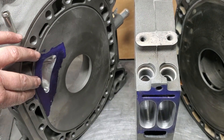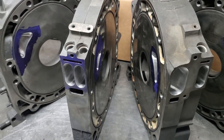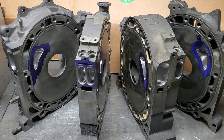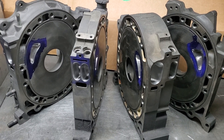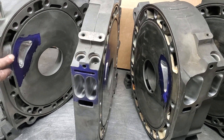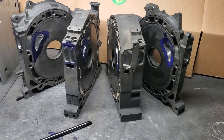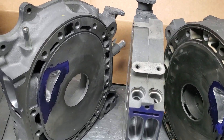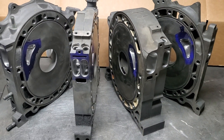We did not modify our intake opening timing. Extending duration allows for more airflow, but changing intake opening timing generally gives more overlap and causes more brap — whether it's a street port, bridge port, peripheral port, or semi-peripheral port. It's really that intake timing and overlap that causes the brap, based on scavenge and port timing.